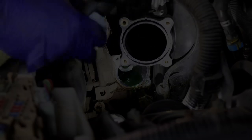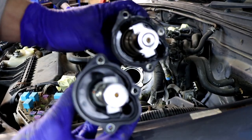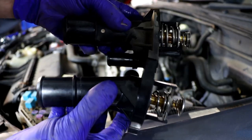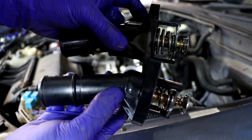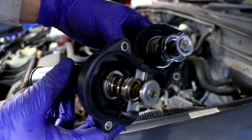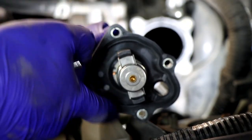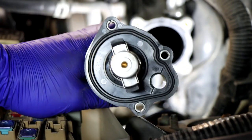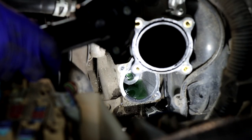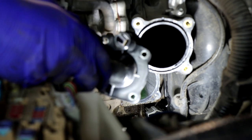I'd definitely recommend double-checking that the new one is the same shape and fitting as the old one. Looking here, they're obviously the same — this one's slightly longer and slightly modified where the hose joins, but it's an updated unit so it's fine. Before you fit the new one, make sure that the rubber seal sits on there properly because if not it will leak. Now we're ready to put it on — it's going to be a bit fiddly because we need to start at least one bolt first. I would suggest starting this one first.